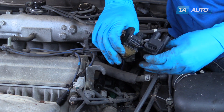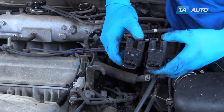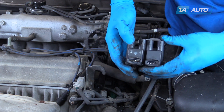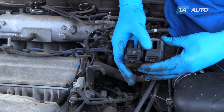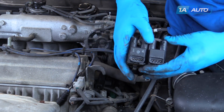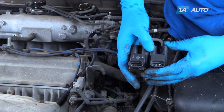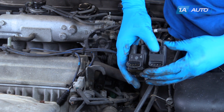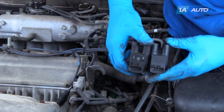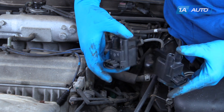As you can see, these parts are identical with the same four-pin connector, same two posts for the ignition coil wires, same two posts for the spark plug wires. You can see our factory one is labeled 1-4, whereas our new one is universal, as these are the same both front and rear, aside from the designations. Our new one comes marked 1-4 up top and 3-2 down below, so no matter which side you put it on, you know which coil wire is going to go on here.